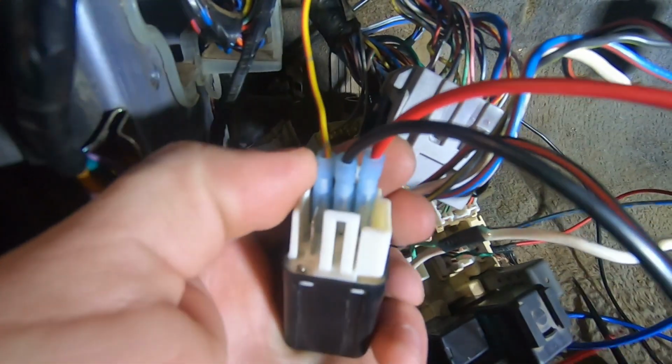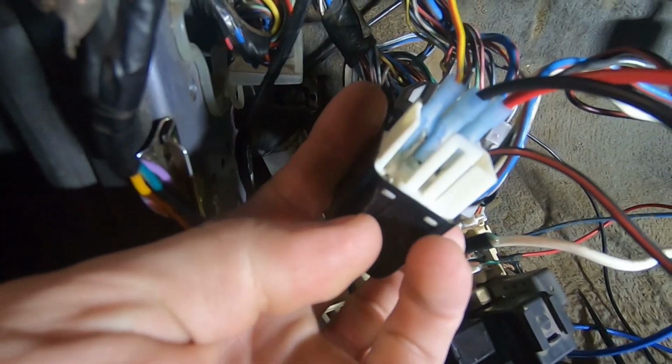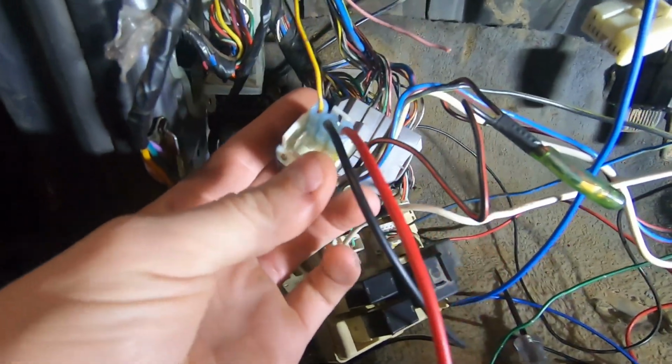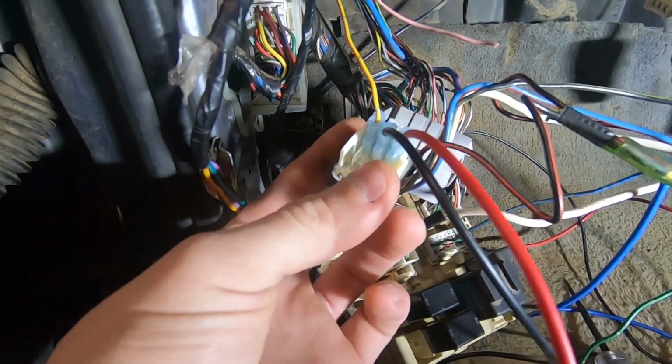It has to have this wire, which doesn't produce a power or even a ground. And then you have your 2 main powers out. But it does turn on when the switch goes to low. So with it hooked up like this, depending on how you run your power wire to the relay, you can be on all the time, or I'm gonna hook it up to where it's key on. It still works properly. When you turn it off on the climate control, it's off. When you click it to low, the relay clicks on, and then it goes from there.